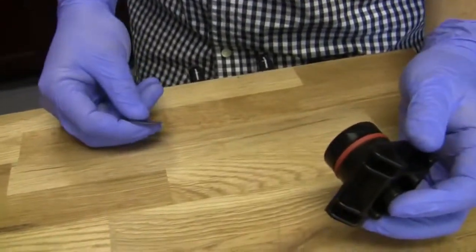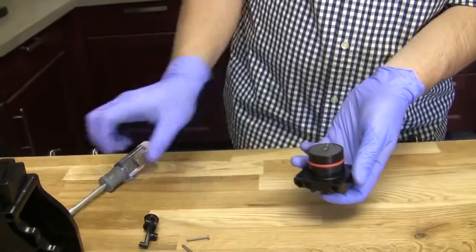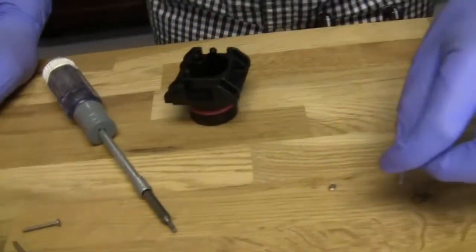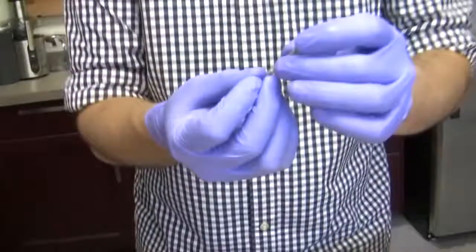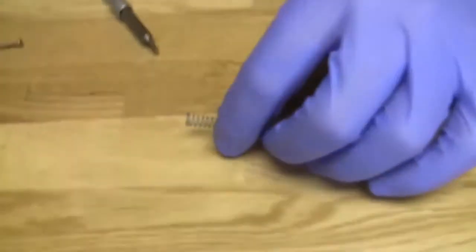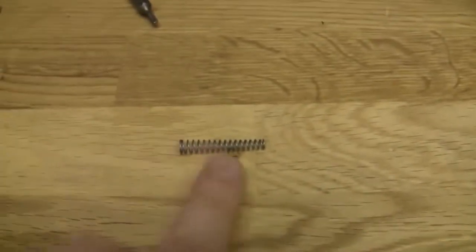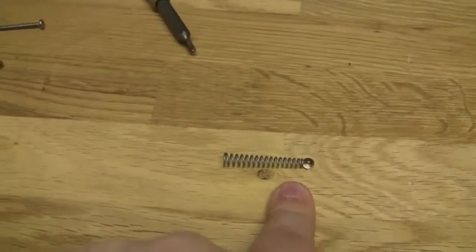How do I get it back together again? Basically just the opposite — there aren't really any tricks. Now, some individuals at home might end up with that spring falling out, so let's take it out really quick just to make sure people know how to get it back together. So there's our glass ball, and there's our spring. This is acting as a seal — when the pump hits a certain pressure, this spring will compress. I want to be sure that if this does come out, you put the smaller edge down. You can see that it is tapered; one edge of the spring is a lot bigger than the other. The smaller end goes downward, and it should sit in there just like that with the glass ball at the bottom.